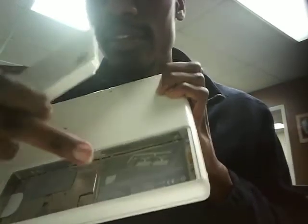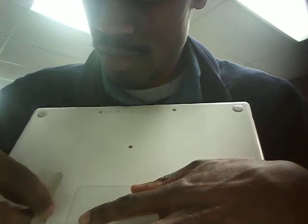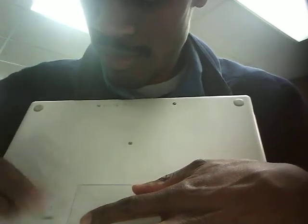Alright, so everything's nice and tight with that. Going back with the battery, take this in first so that it connects onto these little connectors here. It stays in there flat, and you're going to hold this side down while you rotate this. And once you rotate, it's locked. Alright, hard drives are placed.